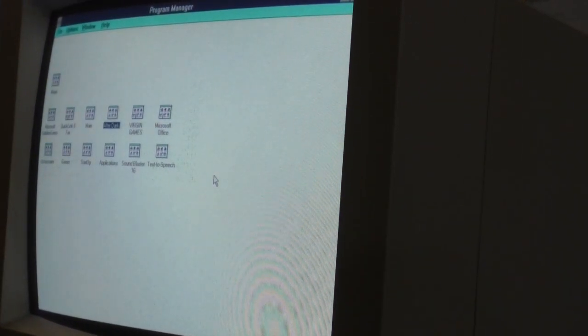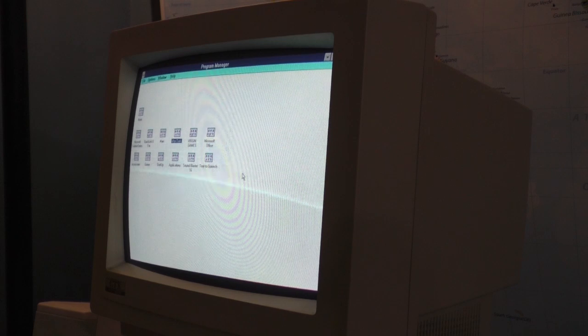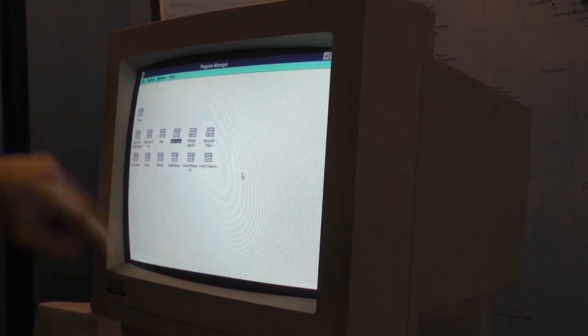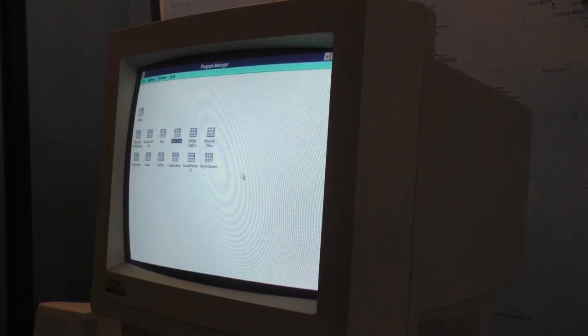So what I gotta do is pop the VRAM chips out one at a time, maybe, until we figure out which one's doing this. Because it's more than likely there's probably just one bad module. And I should be able to find those if I pray and hope that there is a God after all. Now, one way we can eliminate that.